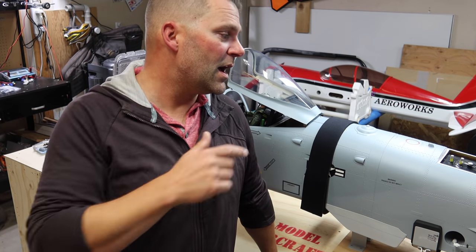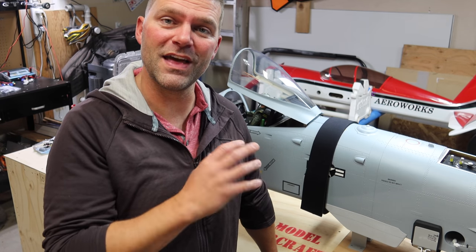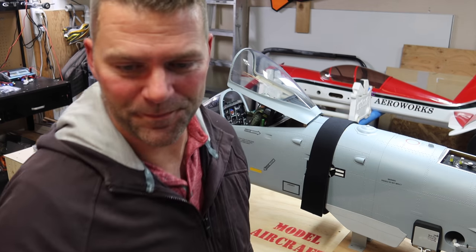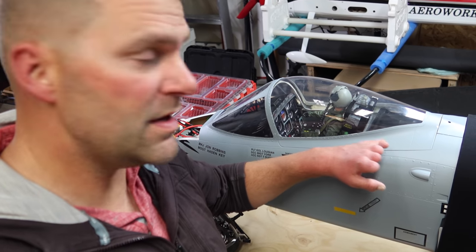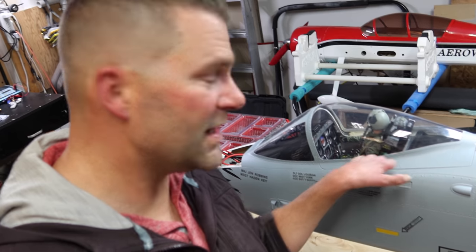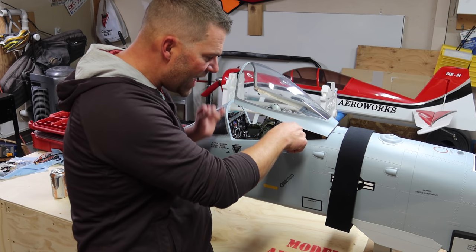With the test runs completed, I've started going over the systems in the aircraft. There's always something that pops up at the end — the gremlins. We've had a gremlin pop up that I actually tested before and it's come back. The first issue relates to the air cylinder that operates the canopy. The air system in that cylinder needs restrictors. We've got to add restrictors to the canopy air cylinder because it just absolutely slams up and slams down. That's definitely one of the reasons to use linear actuators.